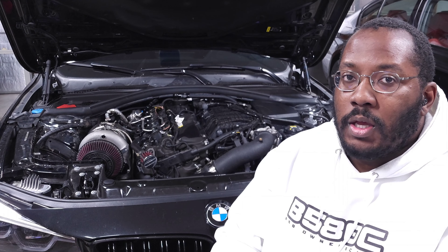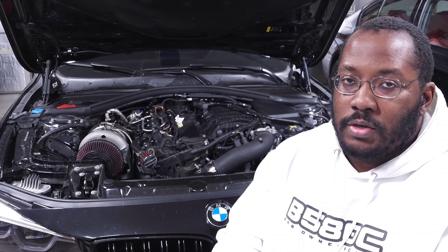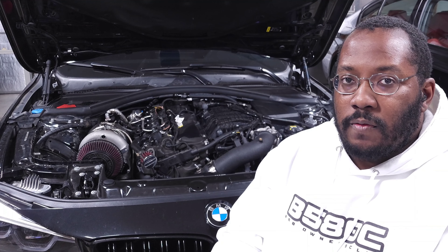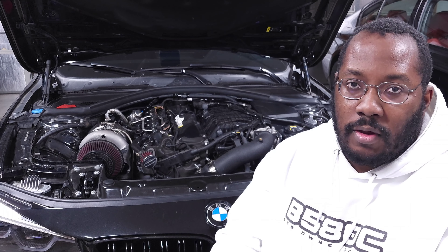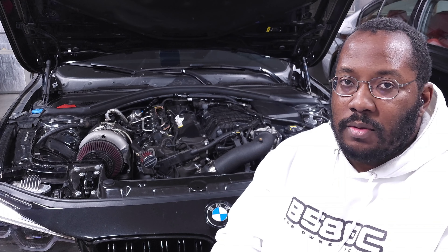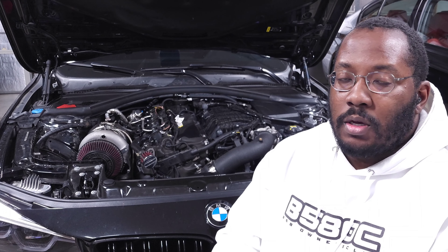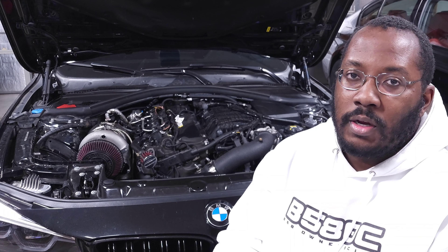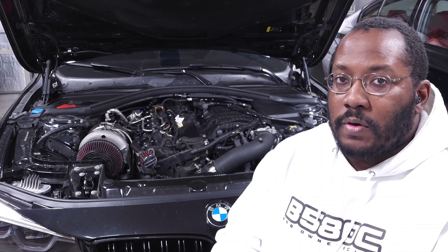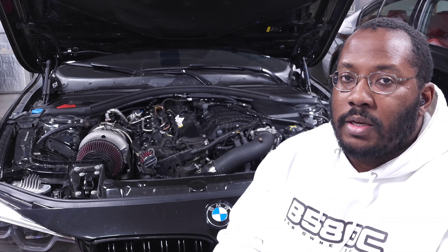Another aspect is that stock suspension is relatively soft, which means you'll get a lot more weight transfer. Weight transfer helps optimize the traction on the rear tire, and even if you're running an all-wheel drive setup like an xDrive 340i with a rear-biased drivetrain, getting as much weight over the rear wheels as possible helps your car accelerate more quickly off the line. Even if you're roll racing and tend to spin in second or third gear, that extra weight on the rear tires helps get as much traction as possible. Overall, stock suspension is typically best — I know people like to upgrade it because at higher speeds it can feel floaty, but for quarter mile or regular roll racing it gives you the best performance down low, which translates to better times and trap speeds.